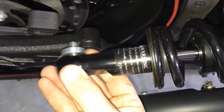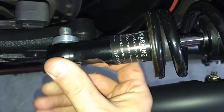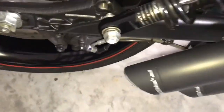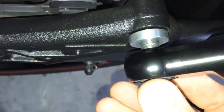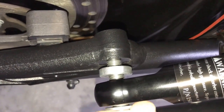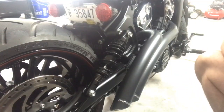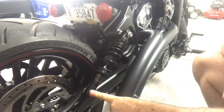Here's the bottom — when it's at rest it's not going to go in there, so I'm just going to sit that there for a second and jack the bike up. You can see the jack is under the bike now, lifted up a couple inches off the ground, and now you can see that it just lines up perfectly. Get that nice and snug, make sure you don't cross-thread it. We're going to go ahead and tighten these down to 65 foot-pounds per the manual.